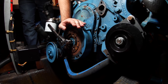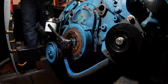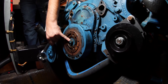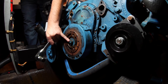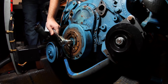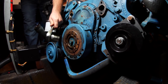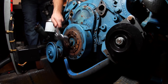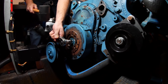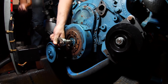I'm back from research and I learned a lot. I don't have the right tool to pull this damper right now, but in about two minutes I will. In the meantime, I've got to pull out this crank bolt — that's the really tricky part because I don't have an impact gun. This is the bolt I've been using to turn the engine. I need a sharp impact, like from an impact gun, to turn that bolt loose without turning the engine with it. What can you do when you need a sharp impulse? Hit it with a hammer.